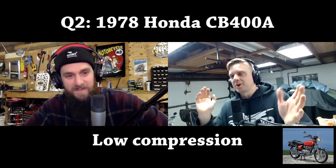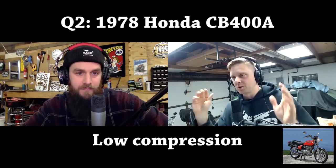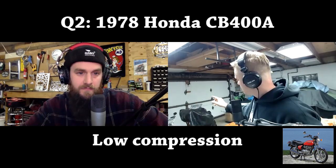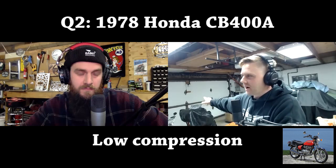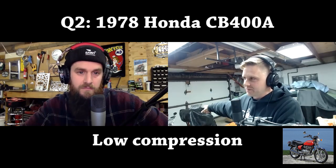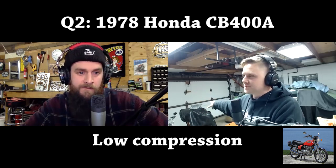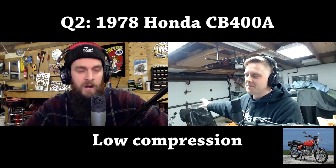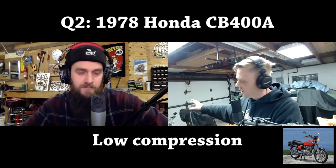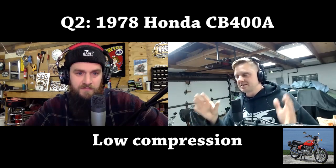But so, here's the thing, guys. If I do a compression test, well, not on the KX250 because that's not a four stroke, but let's say on that engine, on the Chevelle, I couldn't even do a compression test on it. So I went straight to leak down because I didn't have a starter to roll it over. Yeah. The leakage was like 70%. It was massive.